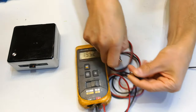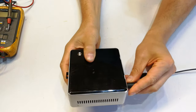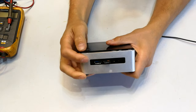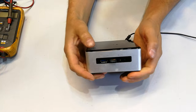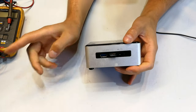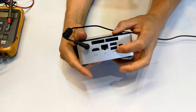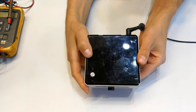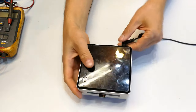Now I plug it in here, and what I noticed is if I put a sound system — maybe a little Logitech two-speaker system — when I plug it in the Logitech powers on, which means power is available on the USBs and on the main bus. So the power is available but when I press the power button nothing is happening, so it's time to open this up.